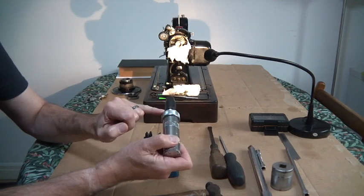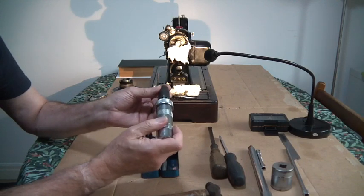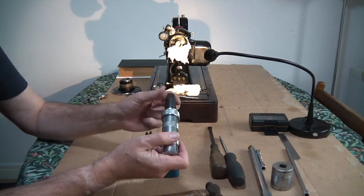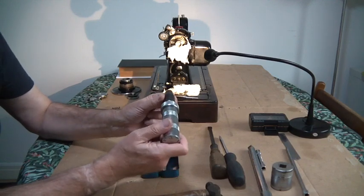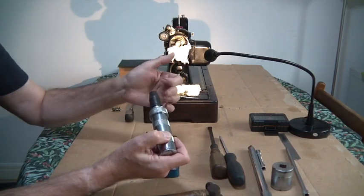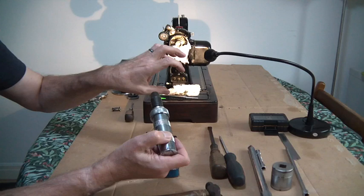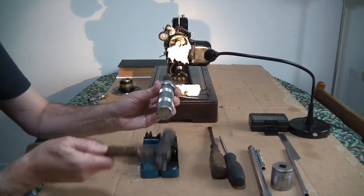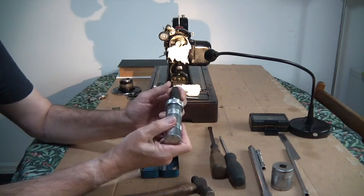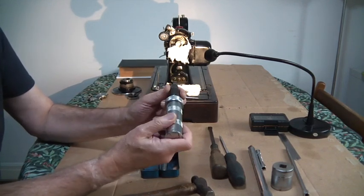Now this one is set to anti-clockwise, so this always undoes bolts and screws. You can either set it to clockwise or anti-clockwise. Clockwise, you are then tightening it all down excessively, by every time you strike it. But I'd use torque wrenches and not this. So I always have this set for undoing things.